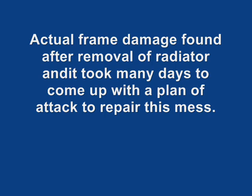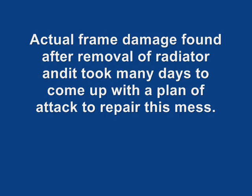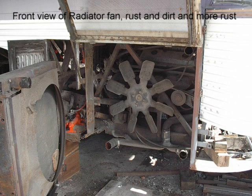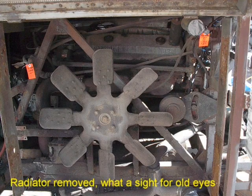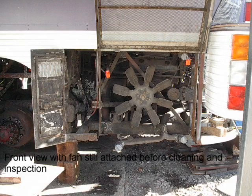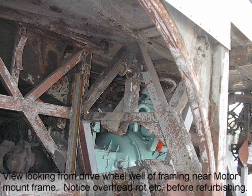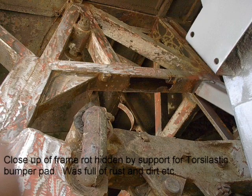Here is the discouragement part of my bus concerning this section, as you will see in the following photos. You will see much frame damage — most important to me is that some of the main framing supporting the engine motor mounts needed complete replacing. The main bus supporting framing was totally rotted through, and that which was not rotted by sight showed failure when pierced with a screwdriver. This took months to cut out and replace to as close as possible to the original design, only I used much thicker material than was originally used.